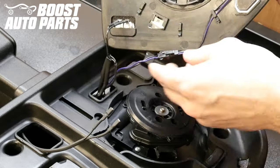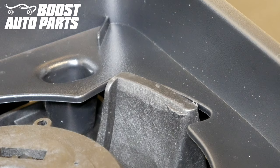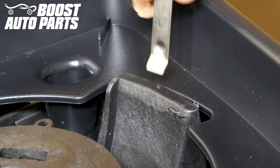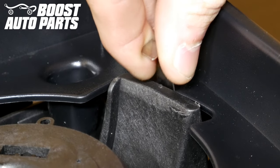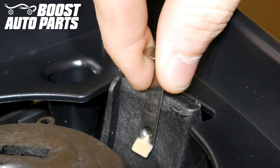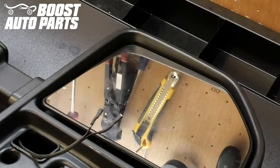Make sure all these wires stay clear of the stabilization pins and motor, then snap the upper glass back into place making sure each stabilization pin slides into each slot. When installing, focus on the three guides — the stabilization pin needs to slide fully down on the inside of each guide for the mirror to seat properly. It does not go on top or behind the guide. Once lined up and centered, press down and it'll snap back into place.